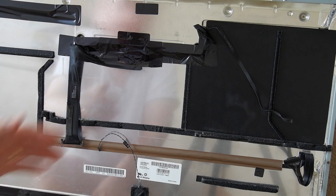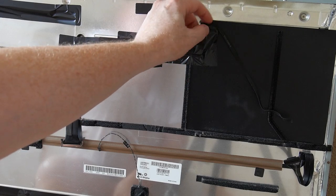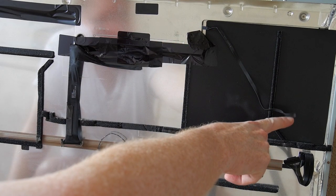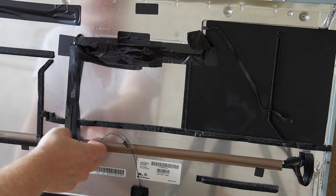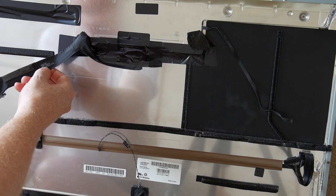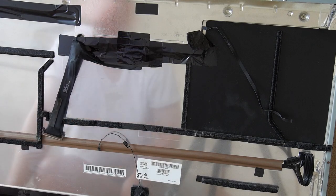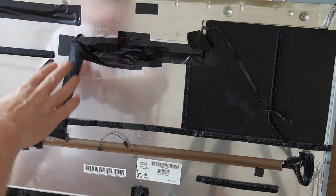But you know, I said, well, since I'm already replacing one cable, the one over here, which connects, by the way, underneath this tape, connects here, and then to the circuit board on the iMac at this end. This cable underneath this tape has a similar connector here, and it's fairly easy to remove once you remove the tape. And this one is a Foxconn brand. It says model number 593-1028-B. So I looked that up on AliExpress, and I found a couple sellers who actually provided both cables.